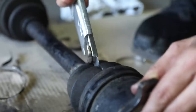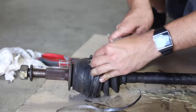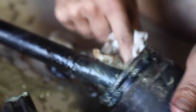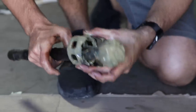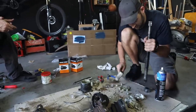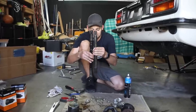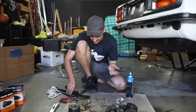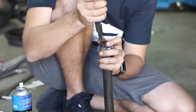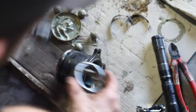Swapping out the axle involves removing both the inner and outer constant velocity joint — it's the thing that means your suspension can go up and down independently left to right, and the drive shaft will still send power to the hub. This axle kit comes with new rubber CV boots, so the old ones get chopped and then I can get the CV joints off the original axle. I've cleaned most of the old grease off and can now install the CV joints — this involves getting the ball bearings back into their cages that contact the outer part of the joint. Then it's a matter of repacking the joint with fresh grease and putting on some new rubber boots.